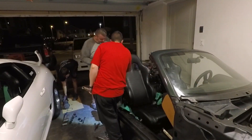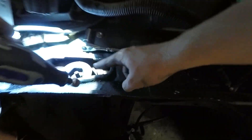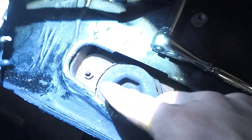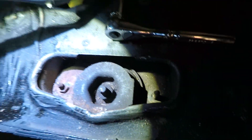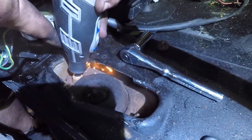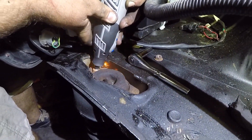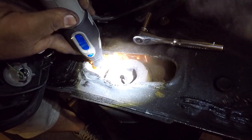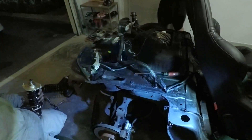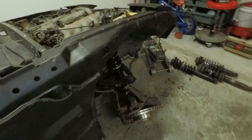All right, two down, two to go. The bolts are so rusty that we have to dremel off the rust - it's fused. So we're dremeling off the whole bolt. So that five-minute coilover install is a couple hours now probably. Mission halfway accomplished, because in the front here it appears we have a broken ball joint.